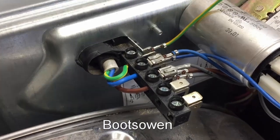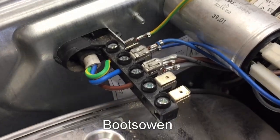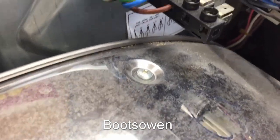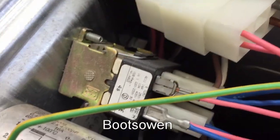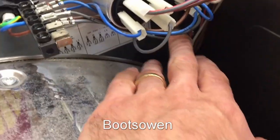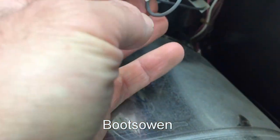There's a power board with bare exposed cables. Granted, the outside is earthed, but bare exposed cables right beside everything that's metal. There's a big capacitor rather than a filter, and I think there's some kind of a filter over there. It should have a filter on it. It also has a fuse down here on the live, but I don't know where that fuse wire goes — it goes to the capacitor. So the capacitor has a fuse on the motor.